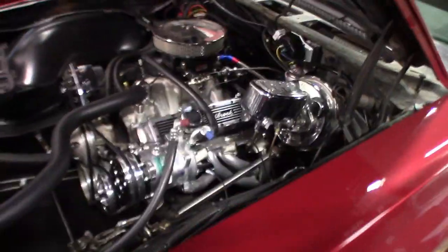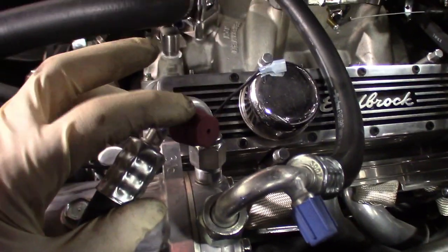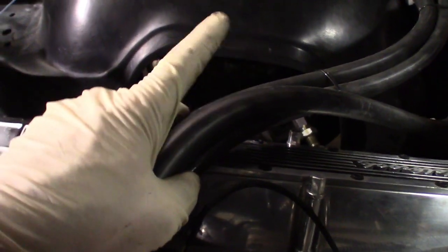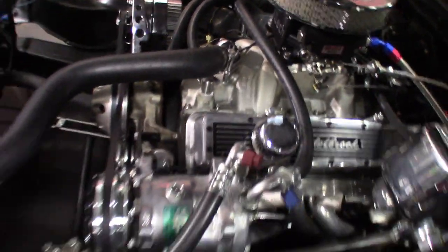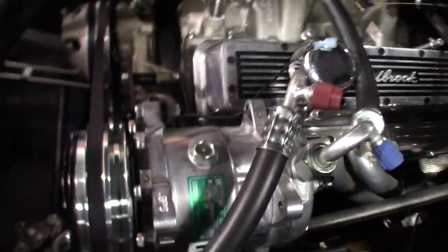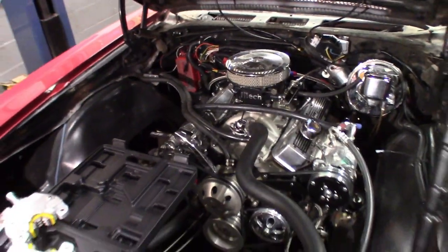So this is what it turned out looking like. Still got to tighten all the fittings up. Definitely looks like we're getting these where they need to be. We should have enough room to get the quick fitting on here. Kind of route it around, going up through here. Maybe bracket these all together or throw a zip tie on there. Ask the customer what he wants to do — he works on this thing too, he did some of the work. There we go — custom AC lines. Got our high side, turned out beautiful. And then the low side, suction and discharge, all done by the Mastercool.